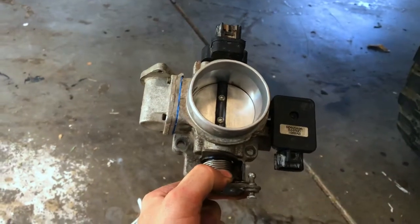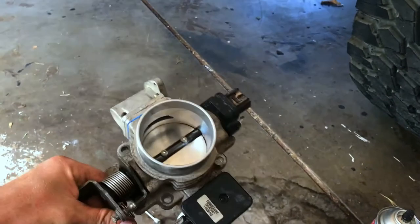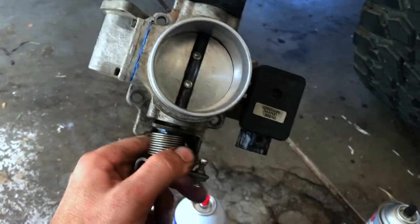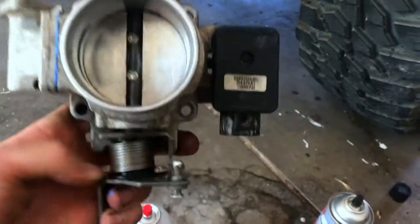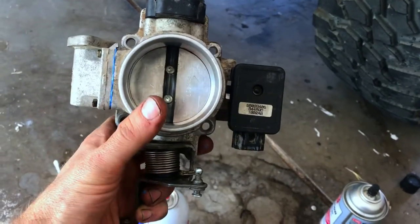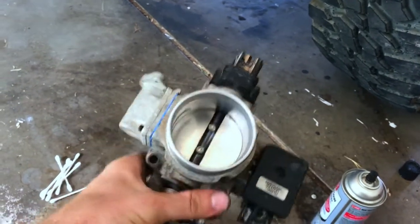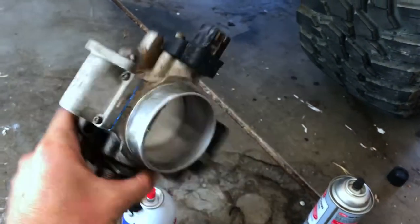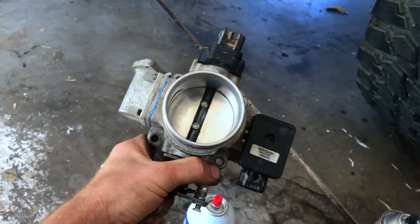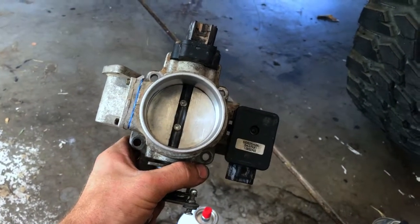It's really important that you put it on the right way. Remember, the springs are on the front, and then this housing goes on the left side, facing the driver side steering wheel. I got my gasket maker in there — it says to wait an hour before torquing it down to torque specs, so I guess we gotta wait an hour.